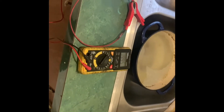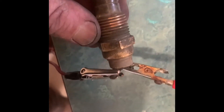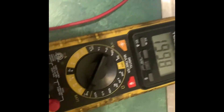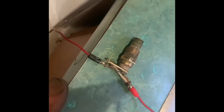We got the old thermal switch out; I put the new one in. There's the old thermal switch right here — you can see it's got two prongs, it's threaded at the top, and that's your sensor. Like I said, it's normally open. I've got one lead going to one side and one lead going to the other side, with the multimeter on continuity. Right now, there is no continuity.